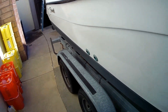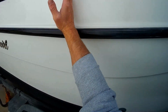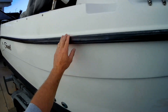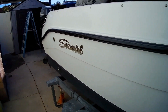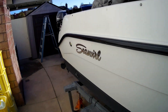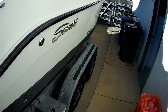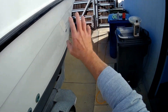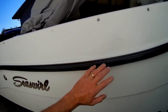Here's an update on the polishing. I compounded from here back that way and even did the rub rail — it actually looks better. It's not perfect but you can see some gloss to it now. This boat is a 2003 and I'm sure this is the first time it's ever seen a polisher. There's a nice reflection and shine to it now. This section — from about here back — took me about 20 to 30 minutes because I did it with compound.